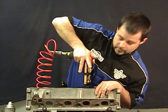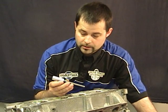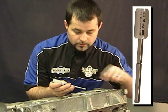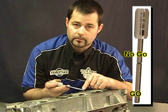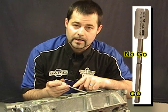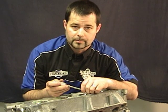Stop the drill and let it come right back up and through. To make sure that you made a good hole, Rapid provides go/no-go gauges. Insert this into the hole — as long as it goes in up to this point you're good. If it goes past this point on the go/no-go gauge, your hole is too big and your liner will not size properly.